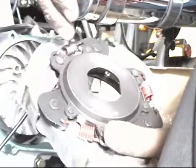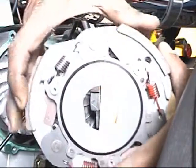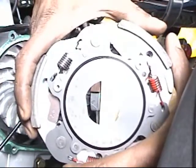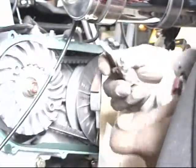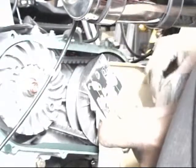And the pillow spring is going to push out and thrust into the compression pack that's in there. So it's going to open and expand. And you can feel this by pressing against the clutch. If you squeeze the clutch, you can see how this works. And just by changing these springs, you can change the rate at which it compresses.